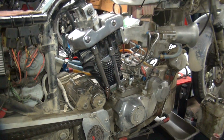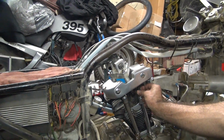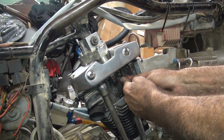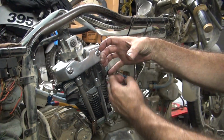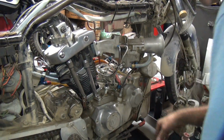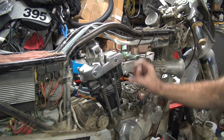Leave it. The push rods and the ball cups are still wearing each other because I can push it and jam it and lock up the push rod. These are top fuel Hemi push rods. They're blanks that I made to fit. See, right now it's real tight on the turn. But if you don't put the side load on, it's free spinning. So the cups are not the same shape. The push rod ball is different than what the cup in the rocker is. Because I'm mixing car and motorcycle parts. Because I had to, because these are this much longer than normal.